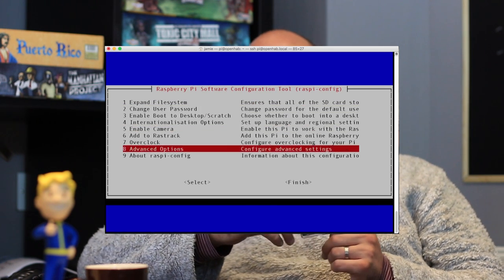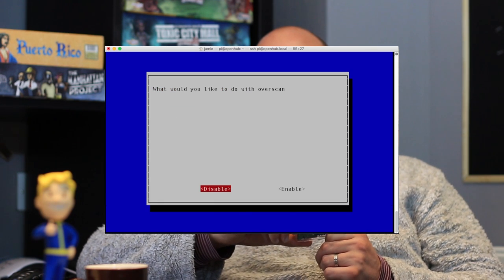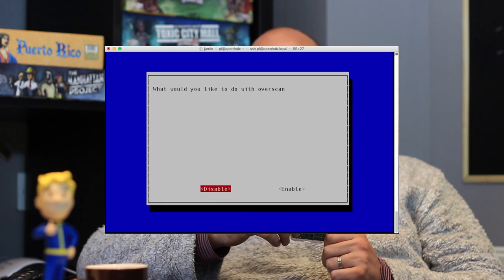But that does require another little adapter. Lastly, a quick note on screen resolution. Regardless of what output method you chose, you may find that the screen resolution is set too high and you can't see everything fully on your TV. In that case you'll need to change the resolution — for instance, if your monitor's resolution is too low you may need to toggle on the over scan option. This is pretty easy: open up the terminal command line and type 'sudo raspi-config', then use the arrow keys to select over scan from the advanced menu, and disable or enable it to suit your monitor.